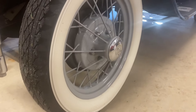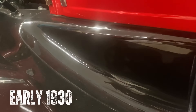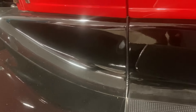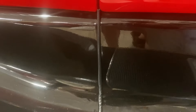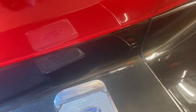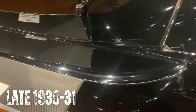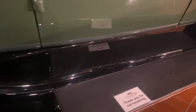Moving past the front wheels, the 1930 Ford Model A started production with two-piece splash aprons. From its introduction in the 1930 model through September of 1930, a two-piece splash apron was used — the front portion was spot-welded to the fender and the remaining portion was an integral part of the running board. The transition to the 1931 one-piece splash apron occurred around September of 1930, making the splash apron one of the possible clues differentiating early 1930 Model As from late 1930 Model As.